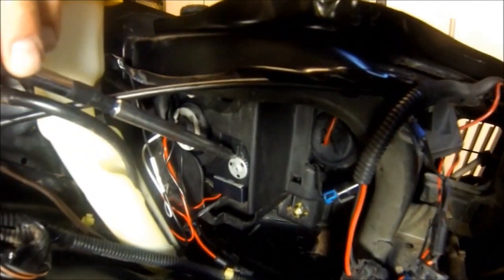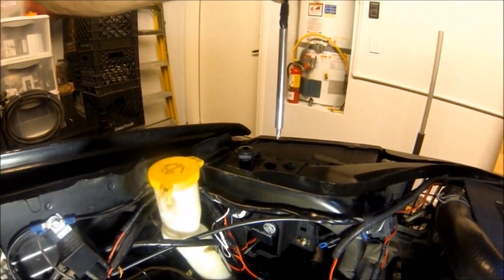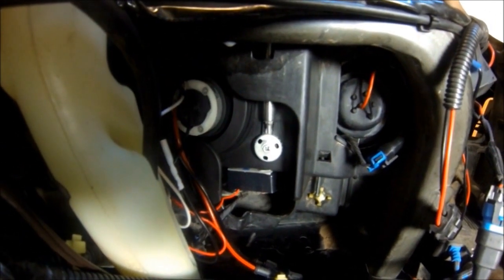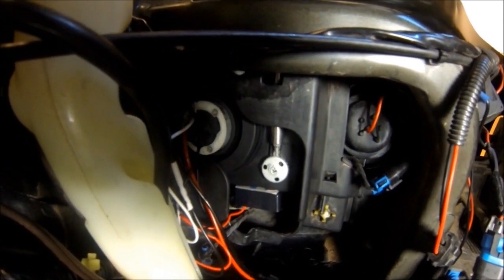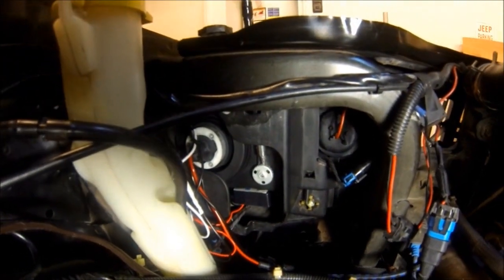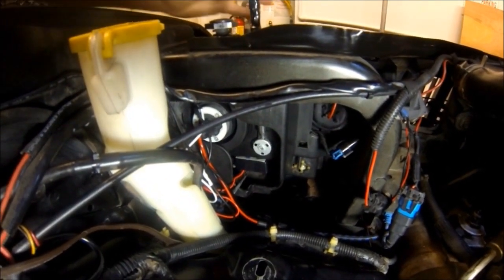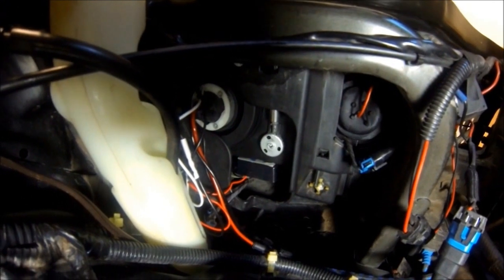What they provide is this wheel — if you look closely, you'll see the teeth on there. You take your Phillips screwdriver, go through the original hole, and come right down like that. This is how you adjust your front headlight. Especially important on the side with the battery — that will be impossible to get to without removing the headlamp otherwise. You just use the stock location here, come down with a Phillips screwdriver, and you'll be able to adjust it without removing the front headlamp. As you can see, it does a nice job.